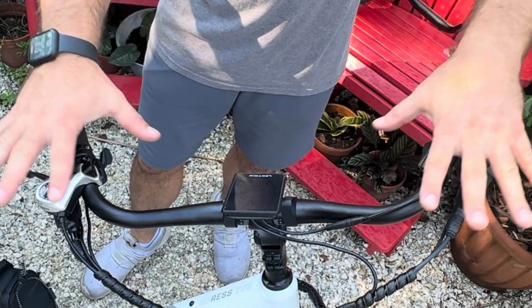Make sure that your cables aren't bound. When you're plugging these back in, look for the imprinted arrows on the face of the connectors and just line up the heads of the arrows — make the points point at one another. Take your screw and nut; the nut goes on basically the front side of the bike or underneath, so put that in. I'm not going to tighten it all the way yet because I want to be able to see what adjustments I'll need once everything is on.